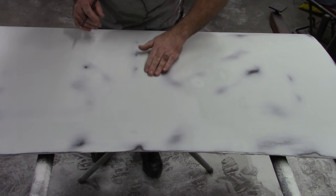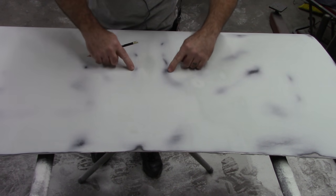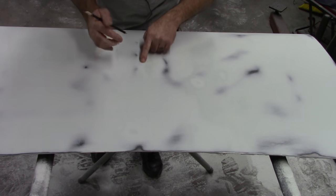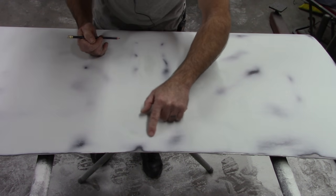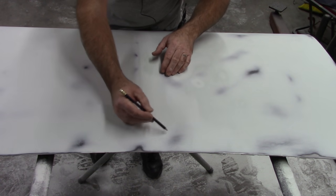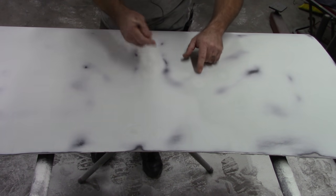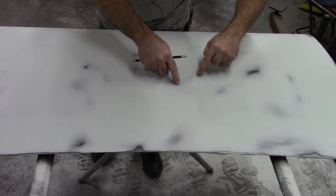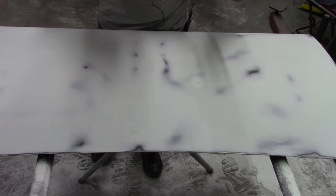And I know it's hard to see, but I'll show you a close-up later on. And when I say bad spots, you can see these are high. So I already knew there was a low spot here, so I'm going to circle that. I know I can see with color variation there's a couple bad spots here, so I'm going to circle those. And then there's one right here, very, very shallow, but you can see there's 3 points here that I'm already reaching the high points of the metal, so I can't just keep on sanding.